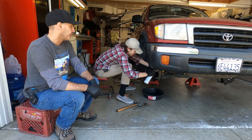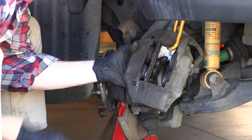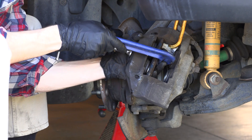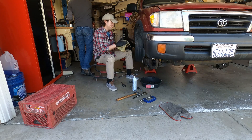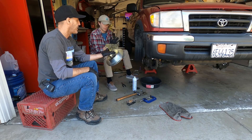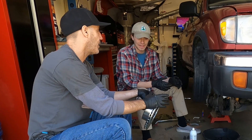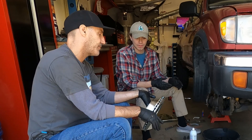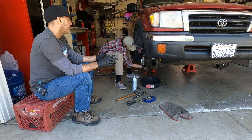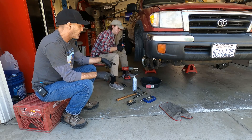Give me that rotor — we'll do a little forensic files on it. It's got kind of the same patterns — a little heat mark in the middle, but otherwise in really good shape, nice even wear. Grab some brake spray and keep spraying inside there — all those pistons — get it all nice and clean. The first bit of spray acts as solvent and continued spray starts moving the residue out. I'm going to have Garrett push the pistons back inside the calipers using one of the old pads and the blue clamp, then flip the pad to the other side and do the same thing.